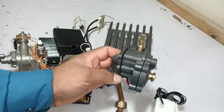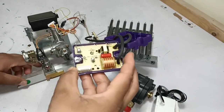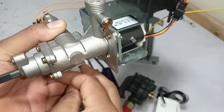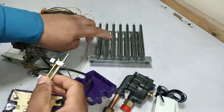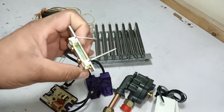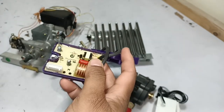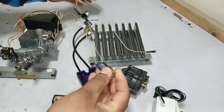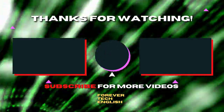When the water is turned on, if the water pressure is good — whether the valve is on high or low setting — the microswitch turns on. When the microswitch turns on, the circuit activates. It has two jobs: first, to turn on the solenoid valve — this is a three-volt solenoid valve — which allows gas to flow at either low or high setting. Then the circuit board ignites the burners, producing flames. After that the thermocouple pin senses the heat, sends signals to the circuit board, which stabilizes the flame, and we keep receiving hot water. As soon as the tap is closed, water stops, pressure drops, and the system shuts down. Thermostats are also installed for safety. I'm tired now — support me on Patreon via the link on screen.